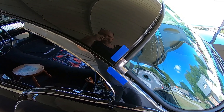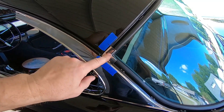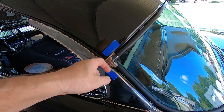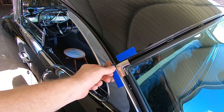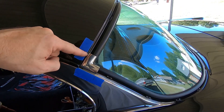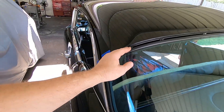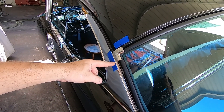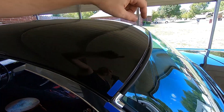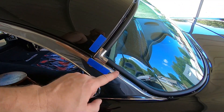When I did the car in mock-up I mocked up these new corner pieces — these are reproductions. On one side I actually had to drill the hole a little further up because the original hole had it a little too low from the roof line, so I re-drilled a new one and welded up the old one. What I did was slip it on here, put some blue painter's tape along here and mark where the end of this trim is, so when I pull it back off and go to get the pieces of stainless trim that snap in, I know they need to be past that line. I don't want to snap the windshield top piece onto here without knowing I need to go past both lines.